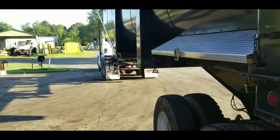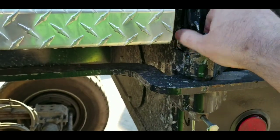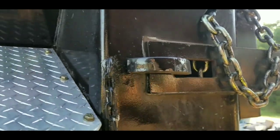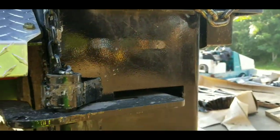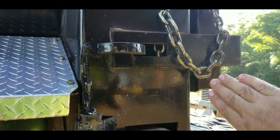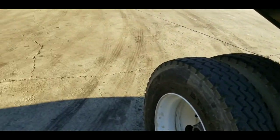Keeping up with the heavy duty theme of the Brazos, there are a lot more latching points. You pull the safety pin, then pull this pin — make sure you take the safety chain off first. You don't want to pop this door open without taking the safety chain off or you'll be in for a hard time. With this system, the latches swing in and out of the way, allowing the door to push open. The reason I said I prefer the Clement is that if someone pushes stuff against the back door, you'll have a very hard time getting the safety pin out — you might even need to unload the back of the trailer first.